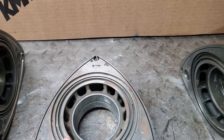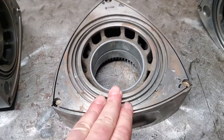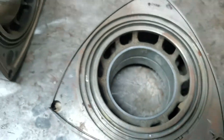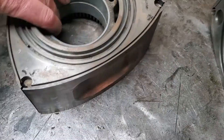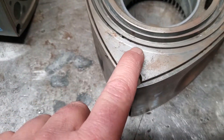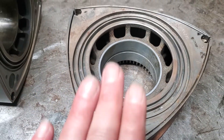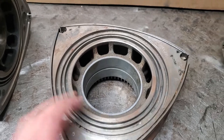Since there's no turbo RX-8 rotors, you're never going to see an RX-8 rotor with a T cast into it anywhere. They are a late model casting, so you can see it's got the step down towards the tip, so the tip has a little more tip clearancing than the land. Most late model rotors are like that.